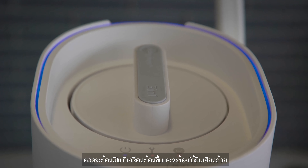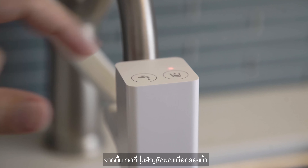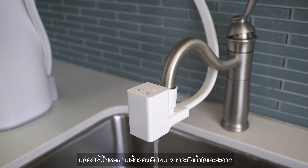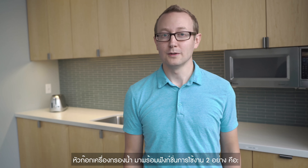The dot on the top of the cartridge should be aligned with the lock icon and the cartridge should be flushed with the surface of the purifier. Now it's time to plug in your water purifier. Plug your purifier power cord into an electrical outlet — the purifier LED lights and sound should come on. For the initial run of any 3-in-1 cartridge, first turn on the faucet and then push the purified water button. Let water run through your new cartridge until the water runs clear and the purified water LED light turns from orange to blue.